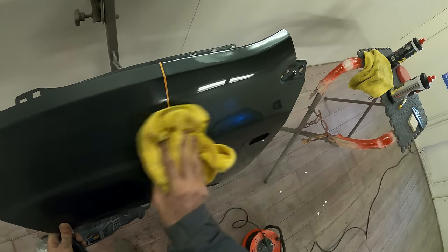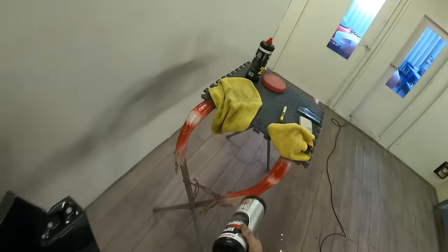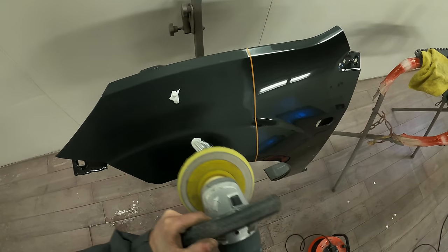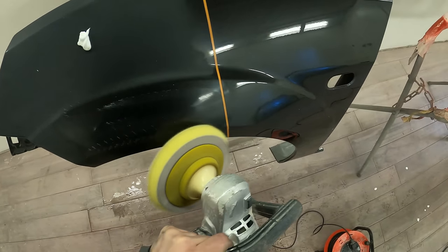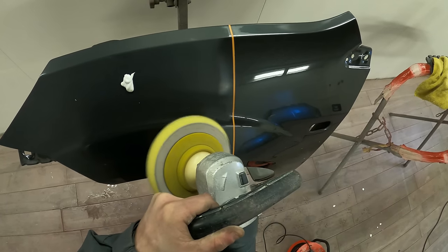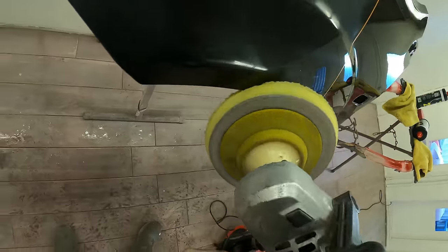This is a very quick and efficient way of getting a really nice clean finish on a panel if you've got a nice clean gun finish. For DIY guys getting a lot more dust, this side of the panel is probably where you'll be polishing more. When I polish a panel I break it up into sections in my mind and work one section at a time until it's completed, then move on to the next. Use a small to medium amount of polish on the head — don't overload it. Too much polish when the pad gets warm will turn hard, start flicking everywhere, grip on the panel, and cause loads of problems.